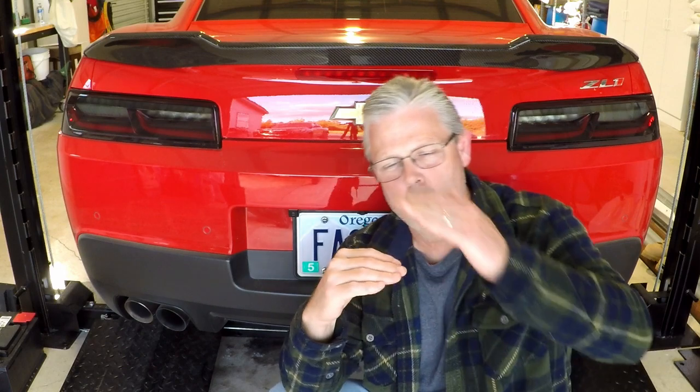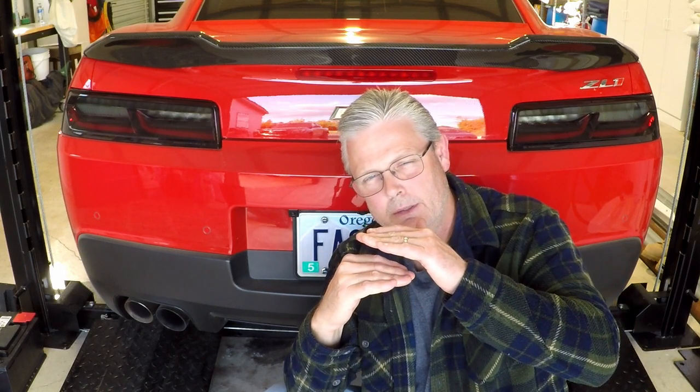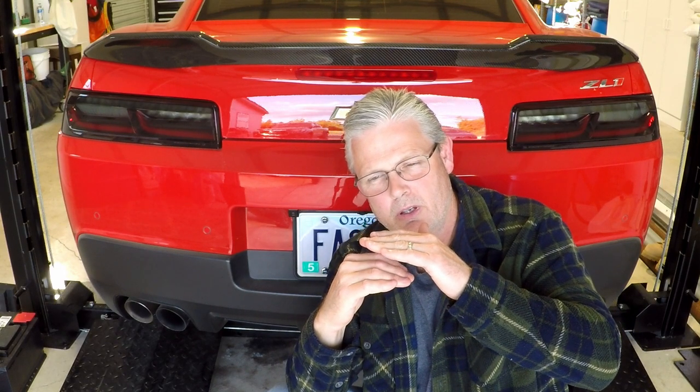The other was the 100 foot-pound torque. It's been 3 months, I've checked it, bolts haven't moved. I was worried about that because the upper and lower mount has a gap, and if you tighten that too much, you can actually bend or break that aluminum since it's going to try to compress that gap. The spec that I got from, I believe it was AFE, they're a solid aluminum mount, very similar to this. In fact, they look almost identical. So that's why I went with their spec.